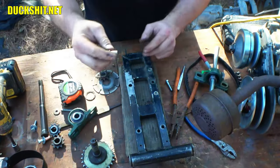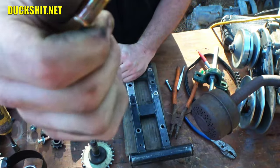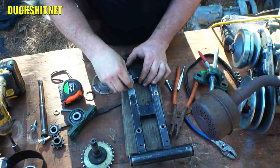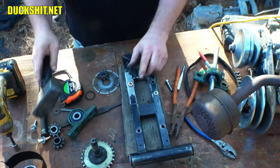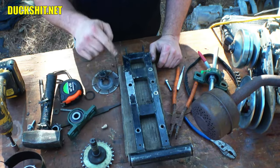Okay, the drill bit we're going to use is actually roughly the same diameter as the riv nut. So when you put these in, you just drill it out to pretty much exactly the same diameter. Then you come out here and get it in there just like that, and then you whack it with a hammer. Bang! Seriously, you just kind of tap it into place, but we'll come back to that in just a second. Let's get these holes drilled.